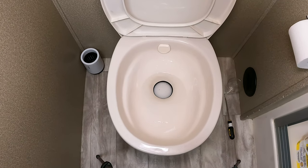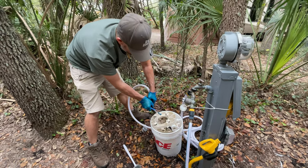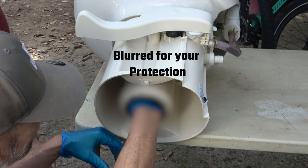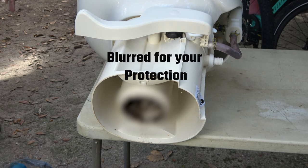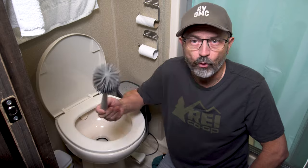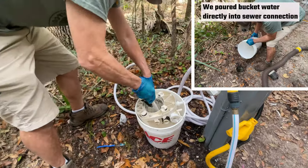This is a three-minute time lapse showing that the bowl is now holding water. The toilet works great now, but there are some really important things I learned while doing this repair. First, before removing the toilet I wish I had taken a hose with a powerful nozzle and cleaned out the inside of the base — this way it would have washed the buildup down into our black tank. I had to clean the toilet manually with gloves, which was a really nasty job. The toilet was about two pounds lighter after I thoroughly cleaned it — about a pound a year of full-time RV living. Make sure you have lots of strong cleaners handy along with something to sterilize everything after you are done. I wish I had bought a cheap toilet bowl brush that I could have thrown away afterwards.